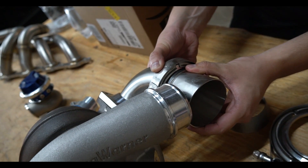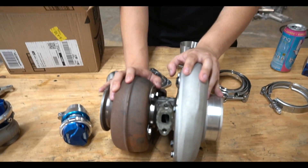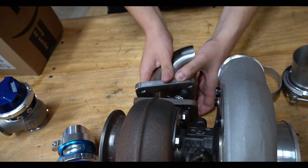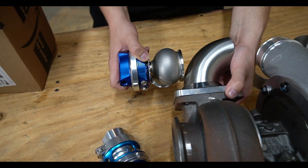I have transitions so this will go to a three inch to fit your normal exhaust — it'll be a clean setup you can take to your muffler shop. Not everybody has a welder, and the whole point of this build is you can take it to your exhaust shop. We'll be working with an exhaust shop for Omar's install, and we'll do a video on it so you have a better idea. The wastegate will go before the turbo and point down to the ground, so when Omar's shooting flames it'll burn up the concrete.